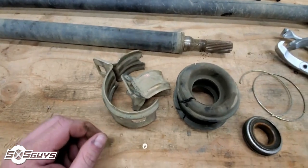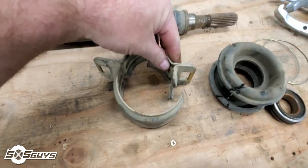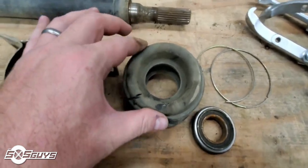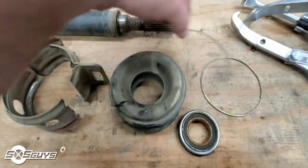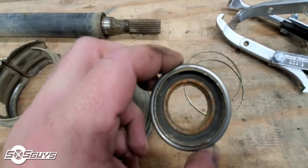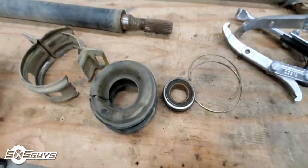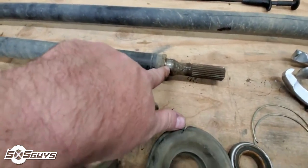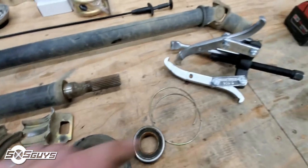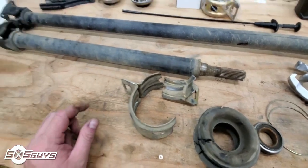Here's what the aftermath looks like. You can see the cage surrounded the boot. The boot is annoying because it has retainer rings inside it. That goes around the carrier bearing, which has a little wobble — it's four years old, so that's kind of expected from OEM. The bearing sits on the inner spline shaft that gets welded in. I used the three-jaw chuck to pull it out and it came out nice and easy.